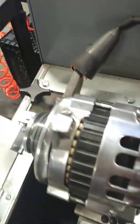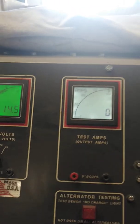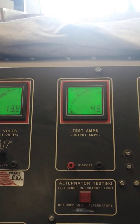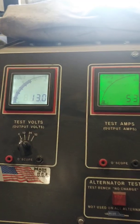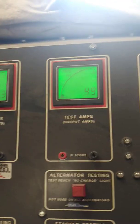On this particular unit, 14.5 volt set point, no load yet. So what we want to show is the unit under load and what the voltage drop is. When we go ahead and add a simple load of, say, 50 amp draw — basically like a couple of fans turning on — you'll notice that the voltage just dropped to 13.3. That's at 50 amps.